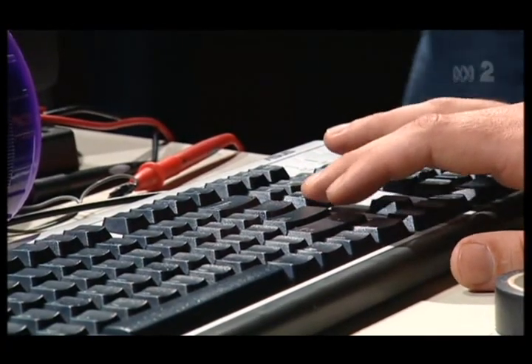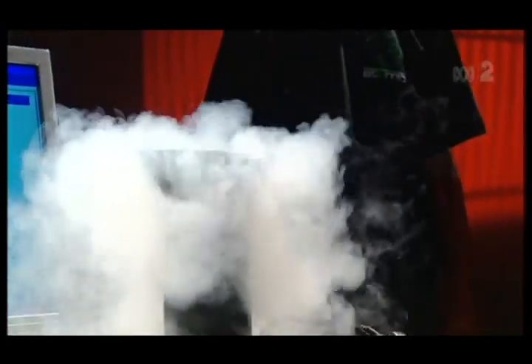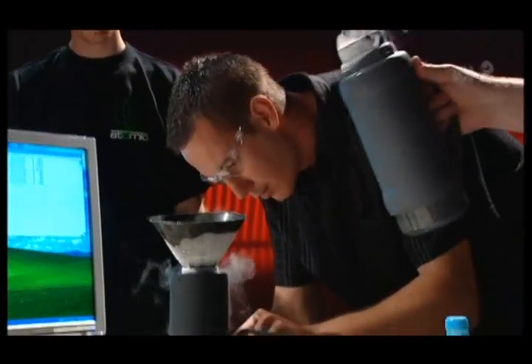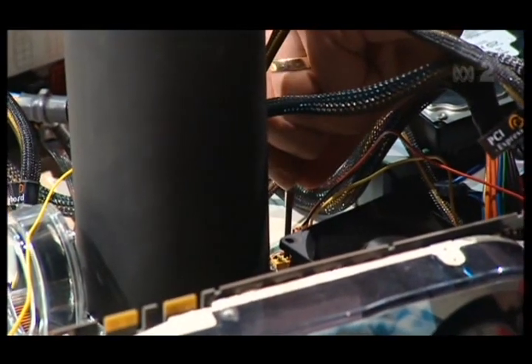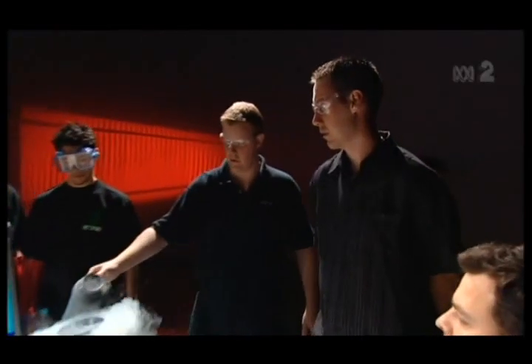So it's basically a way of getting that CPU to run faster than all the other components in the system. The idea is to pre-test everything on air cooling so you know the hardware's limits. I know roughly how hard I can push it without having any hardware issues. When you're benchmarking, you should know what your hardware is capable of and roughly what you can expect.